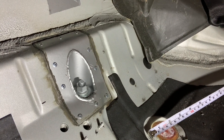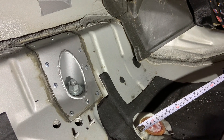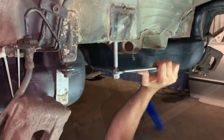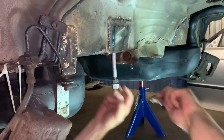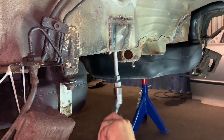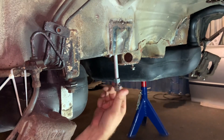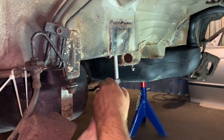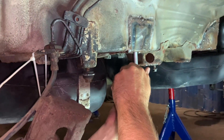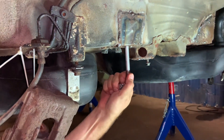I'm going to be crawling under the car now and removing the collar nut and the locking nut — the jamming nut. What you want to do is untighten the jamming nut, and now it's easy to remove the collar nut. Because we have the top side collar nut jamming everything together, we have this as a solid stud — rock solid in there.